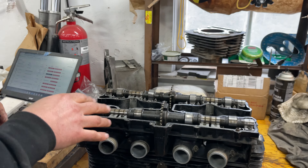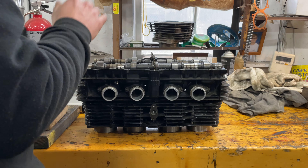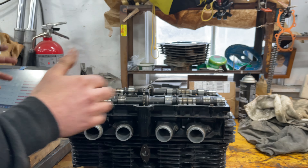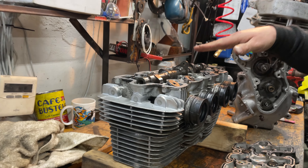Much more advanced design than their 70s version. The 70s Suzuki was also double overhead cam, but had two valves per cylinder. The Honda has just one camshaft — this is called the single overhead cam, or SOHC.